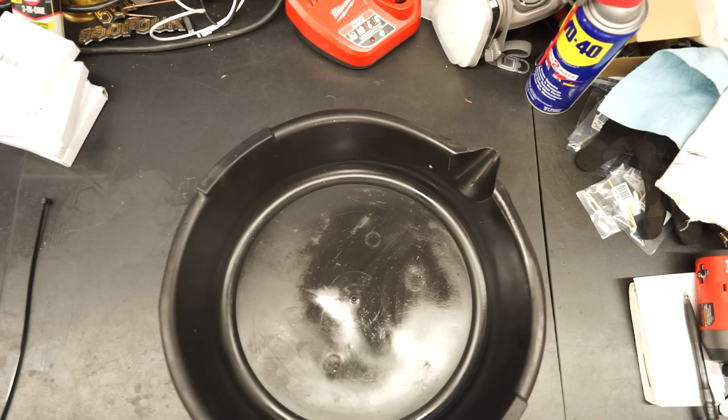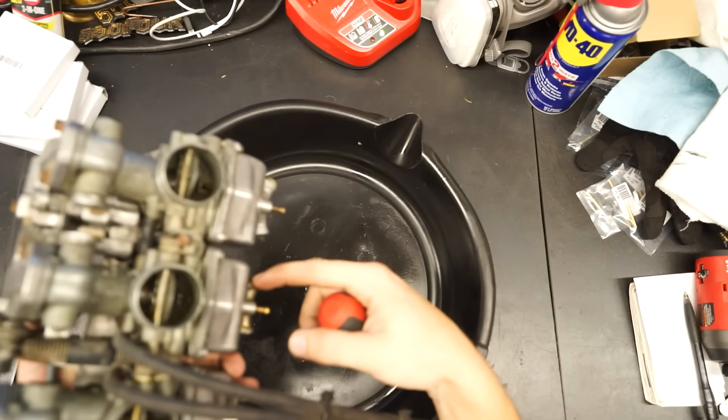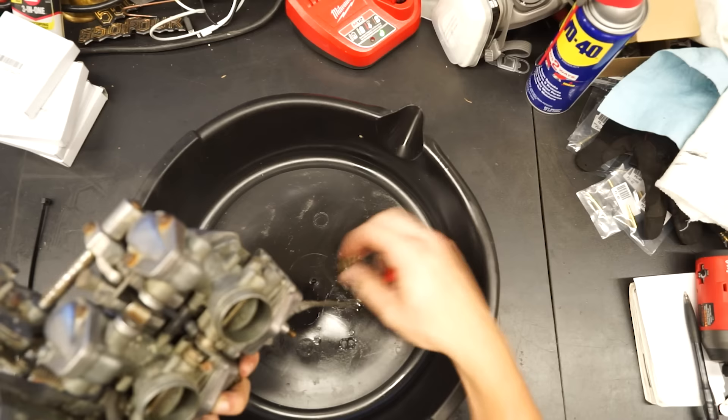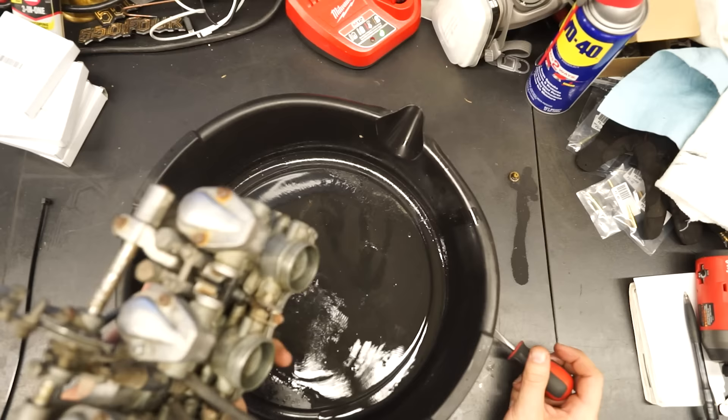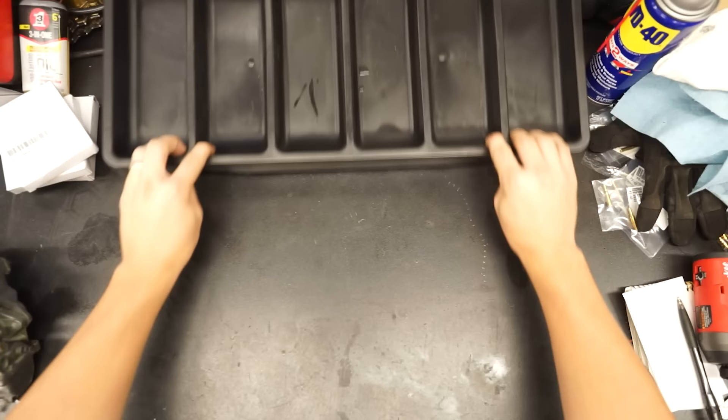I've got you set up with an overhead camera so I can use both hands. First, we're going to drain the fuel out of these. This bike didn't have drain hoses on the bottom of the bowls, so I'll drain using the flathead drain screw on each bowl. We'll let the fuel drain into a drain pan. I got one of these little trays from Harbor Freight — about four to six dollars — to keep parts organized.